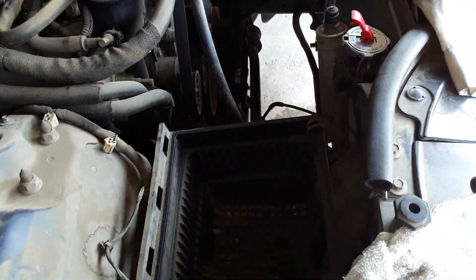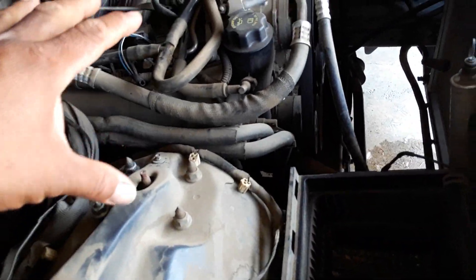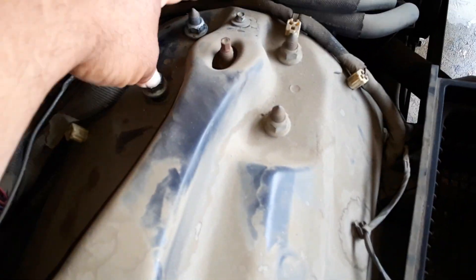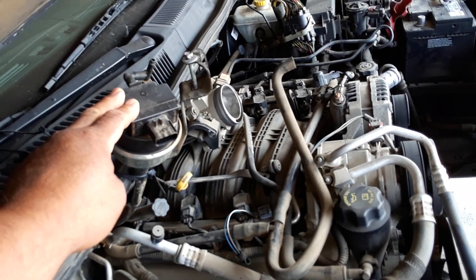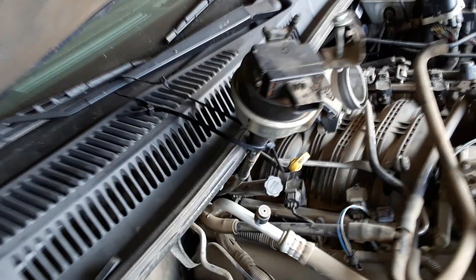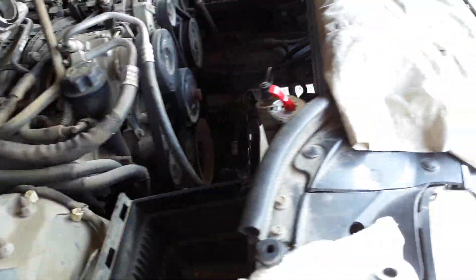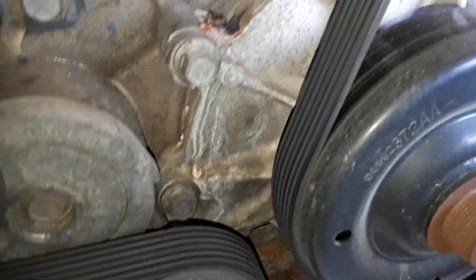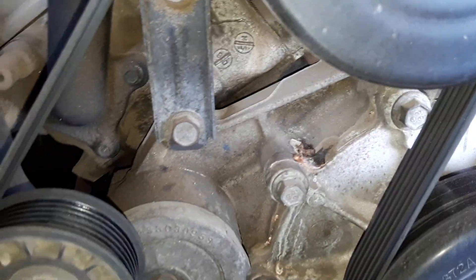Okay, just going to break down what's done so far. Got the air cleaner out of the way so I could get this valve cover off. There's a rollover bar that goes across here that's already removed. This is for the cruise control — got that pulled up and tied out of the way so we can reach that valve cover. I also got the shroud and electric fan pulled out, all fluids drained. I also wanted to point out there's a water pump leak right there, so good thing we got a water pump — I don't want to put this motor back together with faulty accessories.